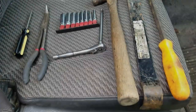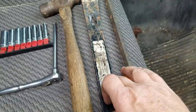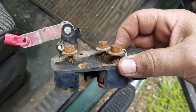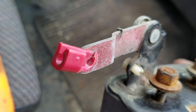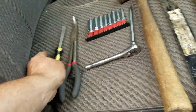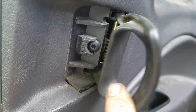Here are some of the tools you're going to need: a pry bar — I use this one for getting the plastic piece off of the linkage, and this other pry bar for peeling the door skin off all the way around. A hammer to gently bump out the vent that's behind the door skin. You need a 10 millimeter to take off the three bolts. Here's the lock and latch mechanism from the bottom of the door. You'll also need this tool to get the push pins out that hold your door skin on, a flat screwdriver, and a torx bit — probably a T10 or T15.